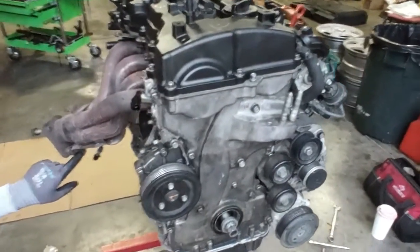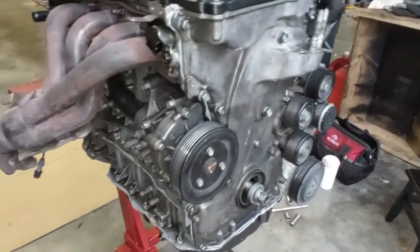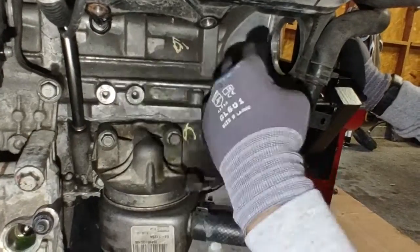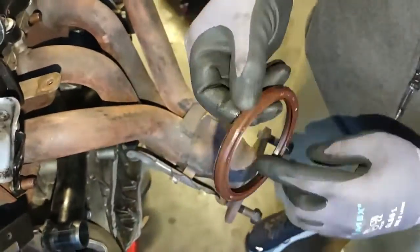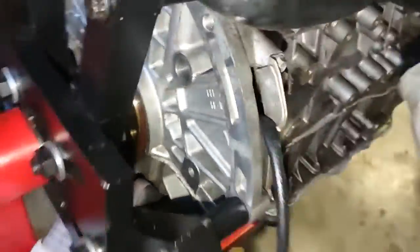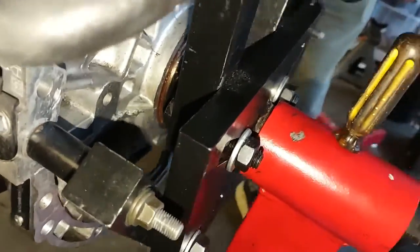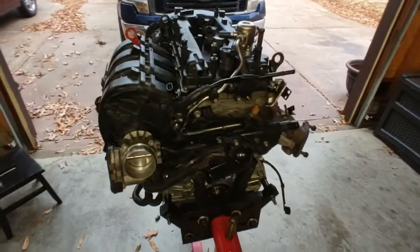The only thing I haven't installed is the exhaust manifold bracket, which goes from here to here. There's also a bracket for the intake plenum that goes from here to here, but I don't install it until after I put the starter motor in because it's hard to get to with the bracket in the way. The last thing to install is the crank seal which goes right here. You could wait until after the engine is removed off the motor mount — it's easier to do it with the engine off the engine stand. This is basically what you need to assemble onto the engine before you put it in the engine compartment.